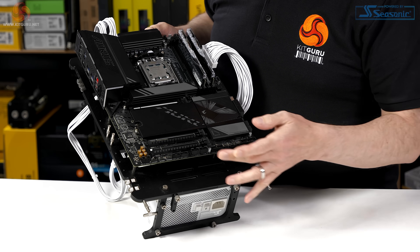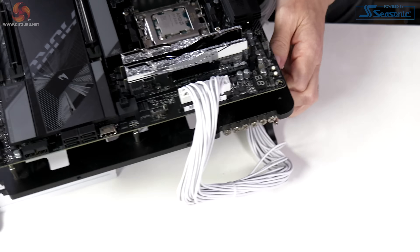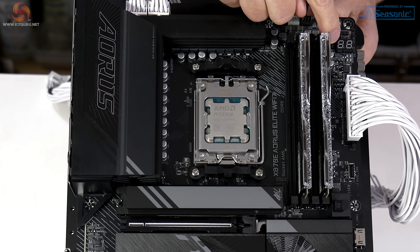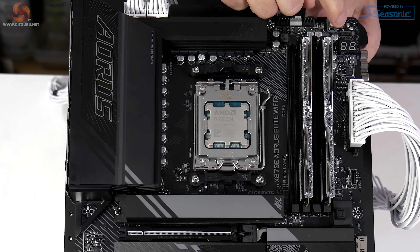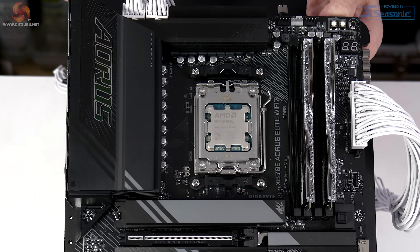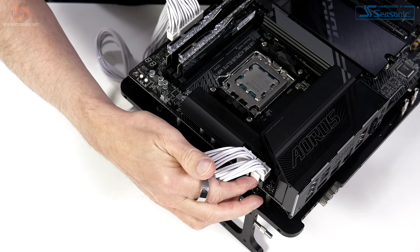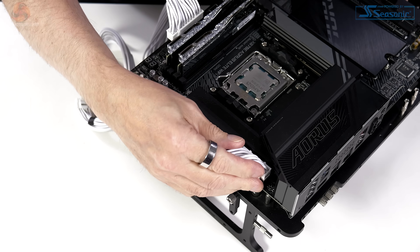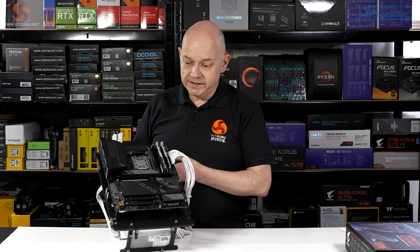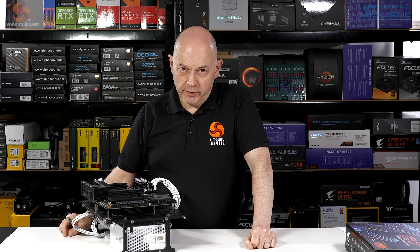The layout of the board is very good. Headers and connectors run across the foot of the board, with three fan headers grouped together. Internal headers for USB and SATA are alongside. At the top of the board there are micro buttons — a power button and a multi-function button (reset by default) — plus a post-code debug display and three more fan headers, followed by the 8-pin EPS. The layout works well and there are plenty of features packed into this ATX design. It's a relief Gigabyte didn't go for EATX, which would require more case space without adding benefit.